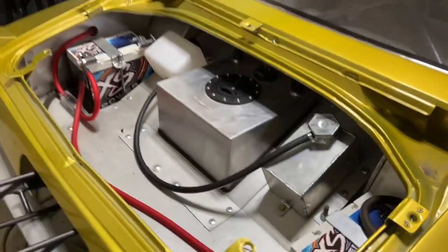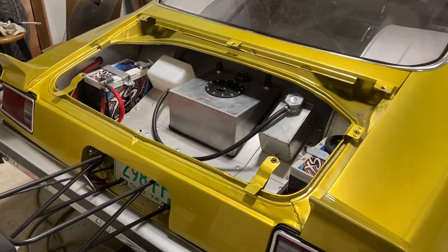Now, this expansion tank is super easy to work with. That's where we fill our water and those water bubbles can escape. The reason you need an expansion tank is because you cannot fill a horizontal radiator without having a bunch of air bubbles in it. This expansion tank cancels that out — it's almost like an extension to the radiator. That's where you add your water, that's where the bubbles work their way out, and we have had no issues with air pockets. Now I'm going to pick the car up and show you guys what the radiator looks like under there.